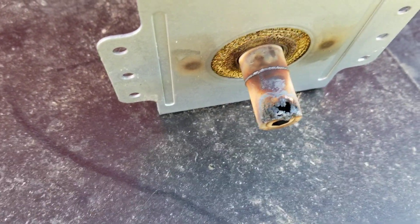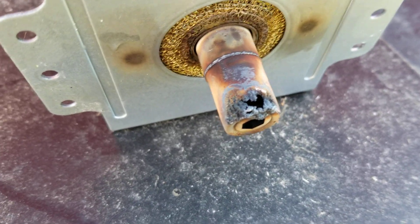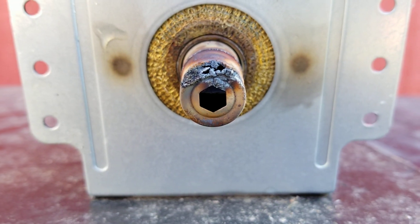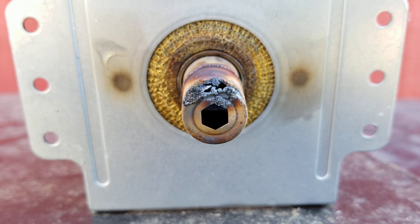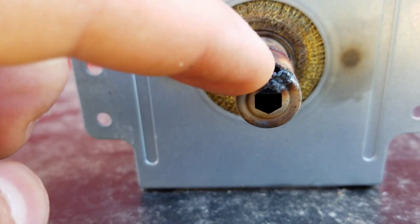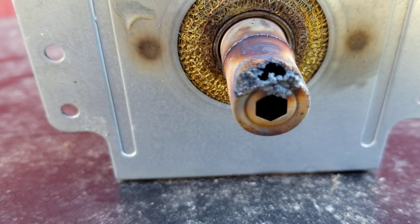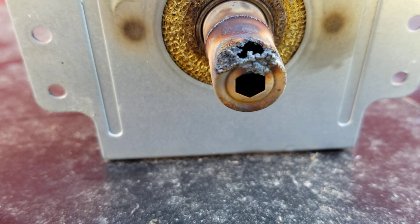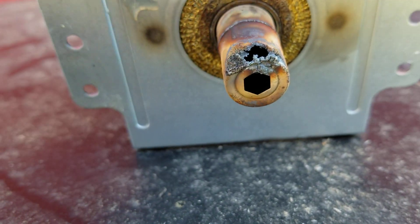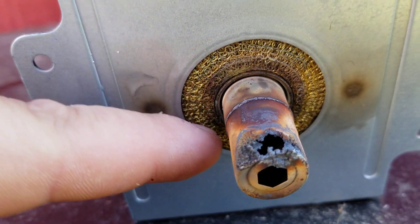We're back, and in better light you can see it is just pitted. The inside looks fine. I haven't plugged it up or tested it, just because of the mold inside. This thing is just trashed — I don't even want to know if it works. Even if it did, the damage is probably bad enough it would still arc. I don't know if it was a ground issue, like how aluminum foil in a microwave builds up electrical charge and arcs — whether the metal shroud was acting like that and arcing over to ground inside the waveguide. Even the gasket around it has some burn marks.